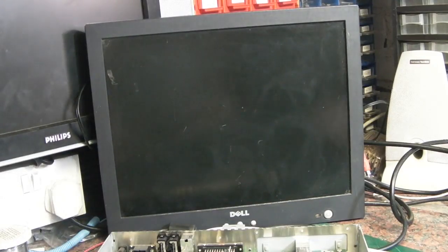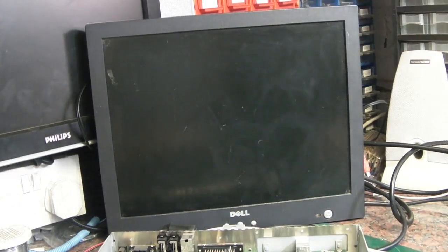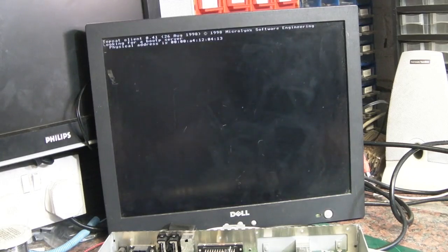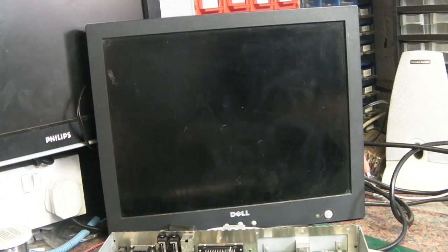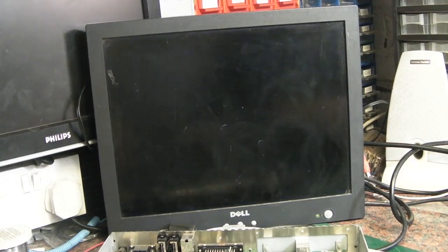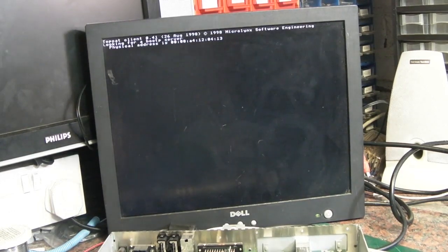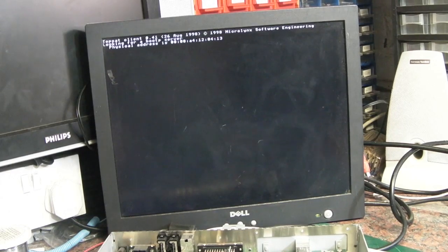I'm back, and I've connected it to an old Dell LCD monitor. Reapplying power — it's exactly the same behaviour but we can at least read it better this time. It shows 'Top Cat' and then reboots. It just seems to come up and then reboot in a loop. I've got the keyboard connected — let me try hitting something. Nope, can't seem to get it to do anything.